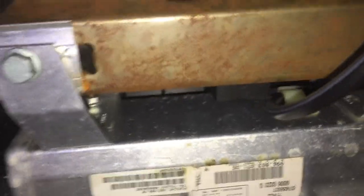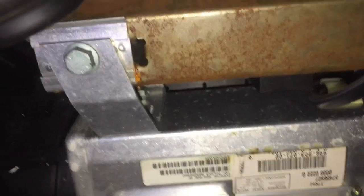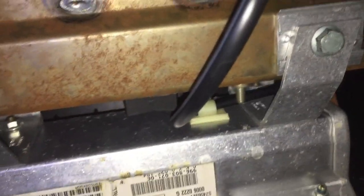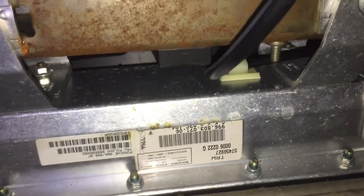You can see one, two bolts. Those bolts go under the dashboard frame, and this right here — the silver piece — is your airbag. So I'm going to put a wrench up in there and take these two bolts off. Once I take the two bolts off and loosen the airbag from the top, I'll re-video and show you what I did.